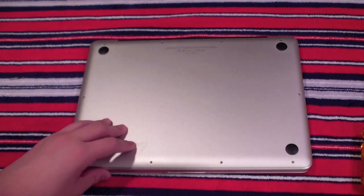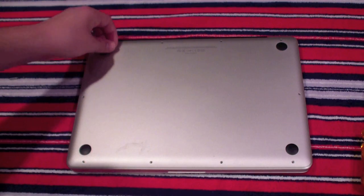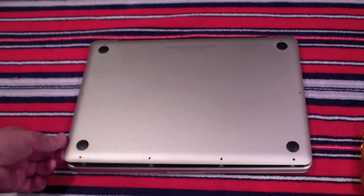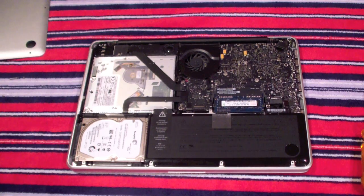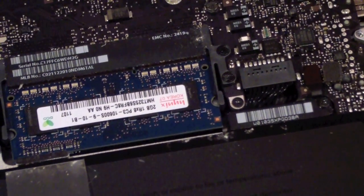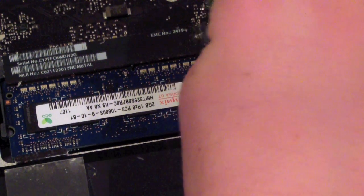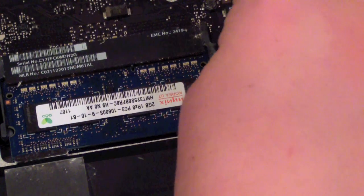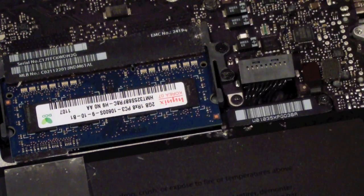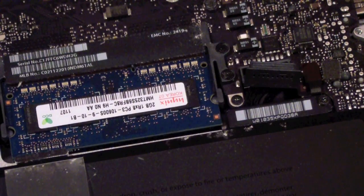An optional tool I was talking about before is a plastic pry tool — you can use it to pry open the case. I just use my fingers carefully, but I'll put a link in the description to buy one if you want. The first step inside is unplugging the battery. This is important because there could still be power going through it. Gently lift each side very carefully, and once you get it unplugged, pull it back so it doesn't re-plug in by itself.